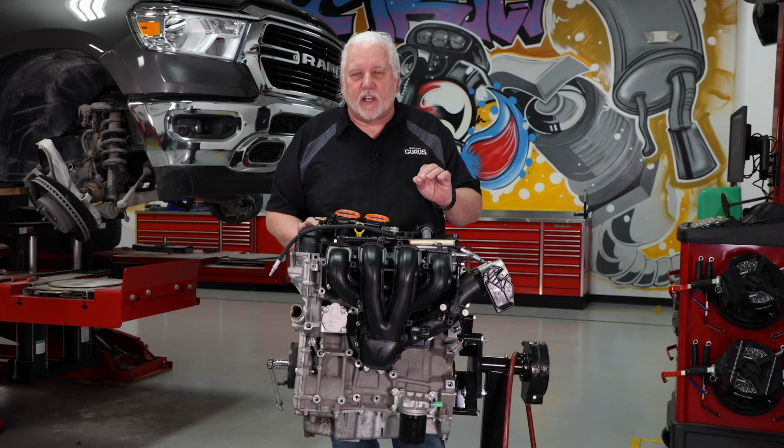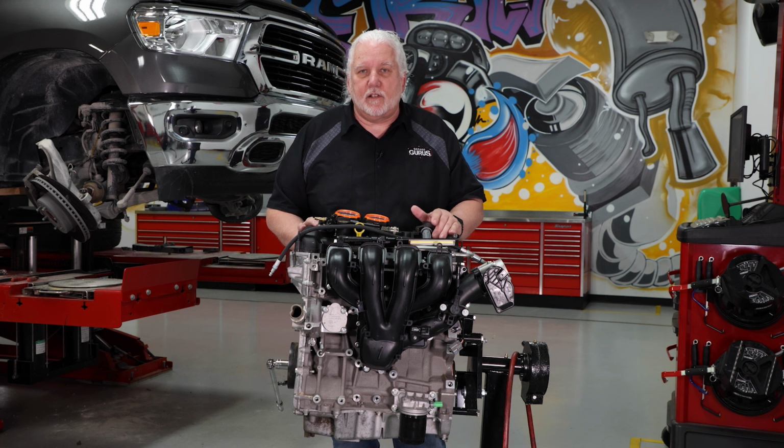These are all things that can cause cylinder seal problems, which will then show up as cylinder misfires, and it's more of what we call a mechanical problem. So we're going to address it more from a mechanical diagnostic angle this morning.